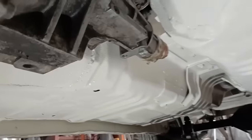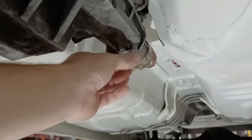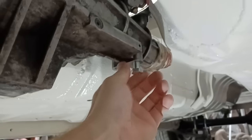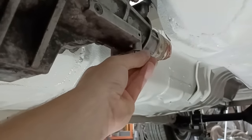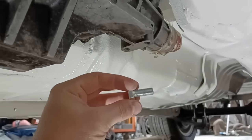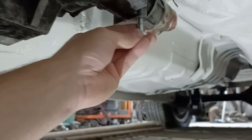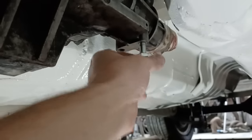Today's challenge is to make a mount using this point here. Now the Japanese have got a funny view of metric — if you try to put an ordinary M10 bolt in here it won't fit. It's M10 by 1.25 thread, not the normal M10 by 1.5. This is a metric fine. They're cheap enough to buy — 8.8 grade strength — so that'll work well.